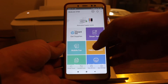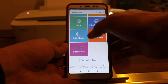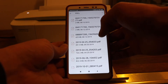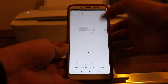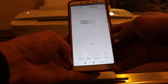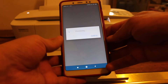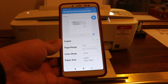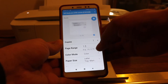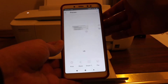Now I'll show you how to do the wireless printing. Simply click on the print document section or select any document from your mobile. Open a PDF or a Word document and click on the print icon which you can see at the bottom. It will send a command to the printer. This process might take five to ten minutes overall. Click on the printer icon and check if your printer is listed at the top.